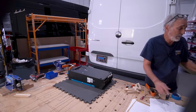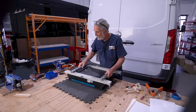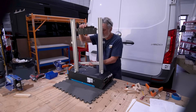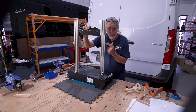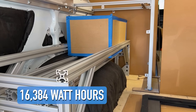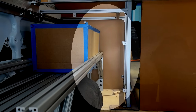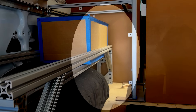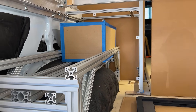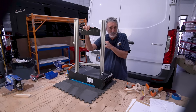What I do is I make my frames out of 80-20. This is going to give me 100% ventilation, and my inverter is going to stay as cool as it possibly could because the entire back is open. I've got two-inch by one-inch 10-series, and I'm going to be mounting it to 15-series. We're going to have two big batteries on this tray wired in parallel — 1,260 amp hours at 12 volts. Look at the space between that thin 10-series and the 15-series rack. That is a beautiful space for the inverter. The Victron MultiPlus 2 has to hang vertically — it's the first thing they'll tell you in the installation manual.